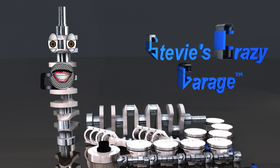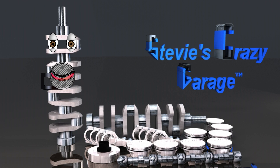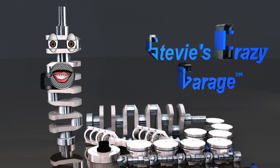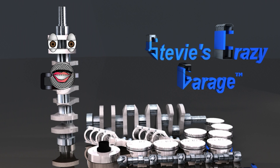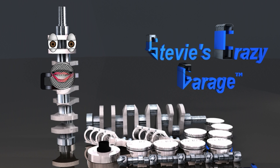If we look at one piston at combustion, when the rod is at the right angle to the crankshaft rod journal and accelerating at something like 4800 G's or better at 9400 RPM, using Newton's second law we see this force acting on the rod journal is about 5 tons for a short time. This calculation is only based on the weight of the piston assembly and does not include the combustion pressure.